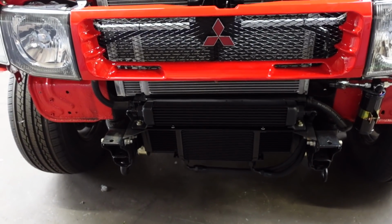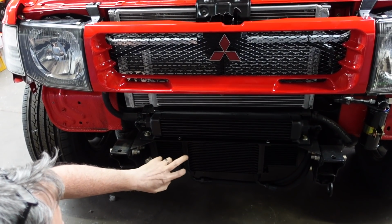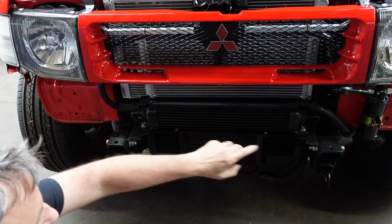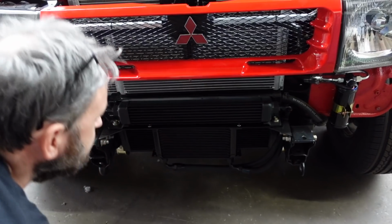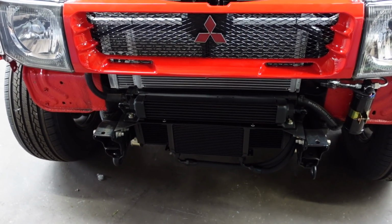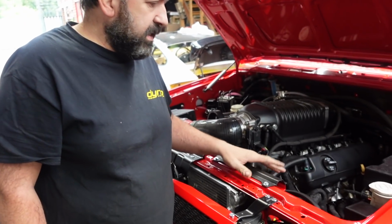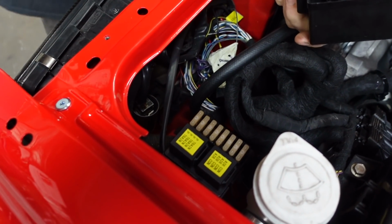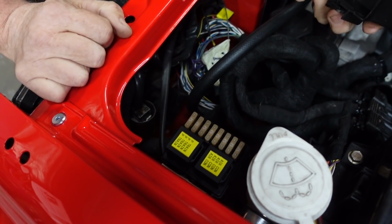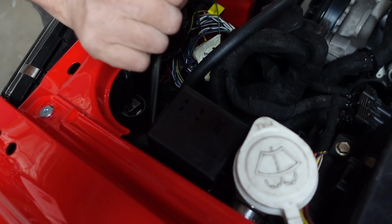Yeah. Fitted, bolted up. So we've got radiator, aircon condenser, charge cooler, engine oil cooler, gearbox oil cooler, aircon receiver jar. In theory, the aircon is ready to gas up and try, and hopefully I've got no leaks. And in theory, that's wired in as well, because you have to wire in everything. This is a little box like a little fuse box that comes from the powertrain. It basically just powers, they're like 25 amps in America. Right. So that powers up the ECU and separate control.